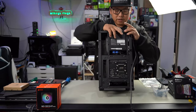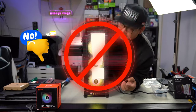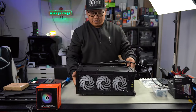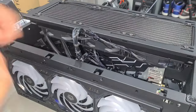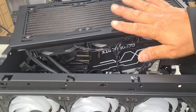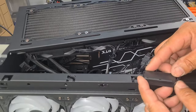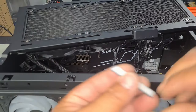Let's plug in our power supply and turn it on — really excited for this. That sounds absolutely horrible, so we've got to turn it off straight away. Looking at it, I can already see the problem: there's a fan cable here that is touching the back fan blade. Let's grab the zip ties — very simple fix. Nice and tight, cut off the extra. The problem was that when I pushed the AIO radiator in, all the cables came out and started touching the back of the fans.